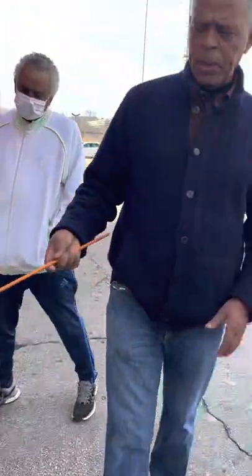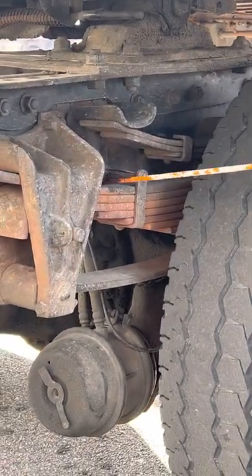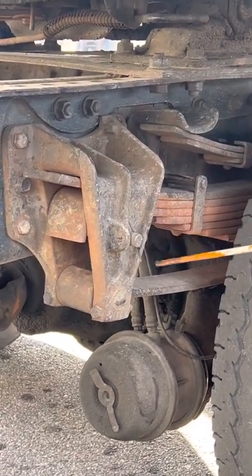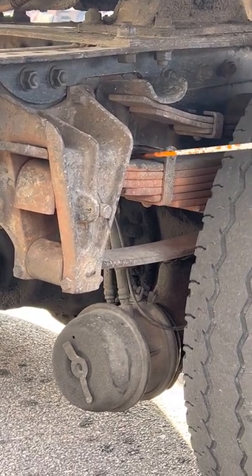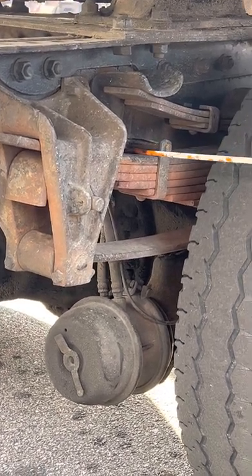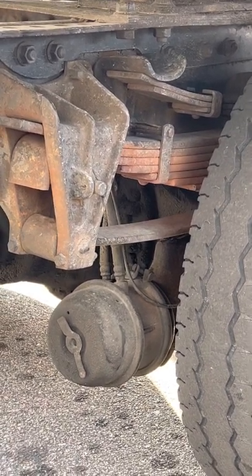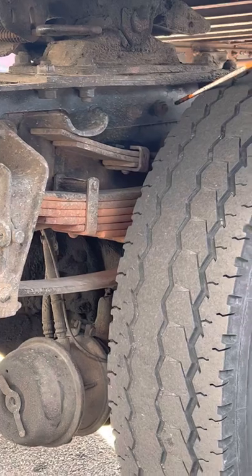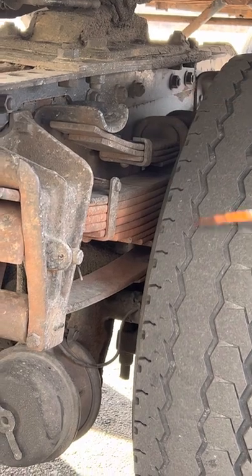Once you complete the wheel, you're going to move inside. When you move inside, you can find the suspension. We have rear suspension here. We have mounting bracket also — we have bolts and nuts, should be tight and secure, no missing or loose on the mounting bracket, no damage on it. And we also have leaf spring suspension — we did the same inspection as we did on the front. The leaf spring — no cut, no crack, and also no illegally welded. As a group, make sure they are not missing, they are not shifted — if one is missing, the vehicle has to be out of service. And we also have U-bolt in the middle — no damage on the U-bolt, the bolts have to be tight and secure, no missing or loose.